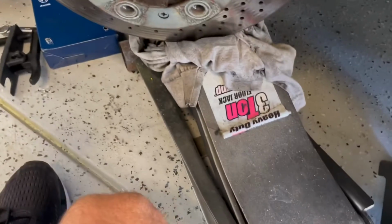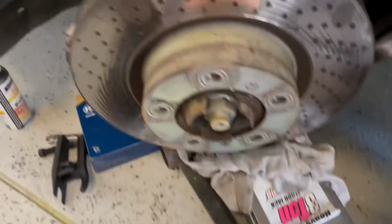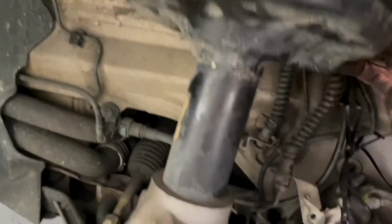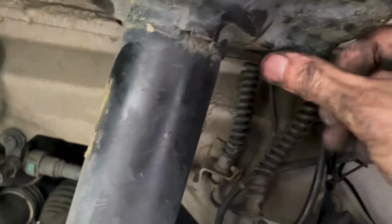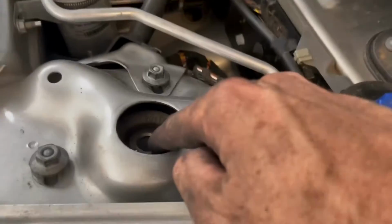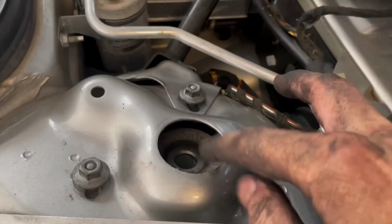All right, so now I've got my jack on the bottom of the A-arm. I've got my spring in and it's indexed into this little detent down here, so it's up against that as far as it'll go. Got the strut mount in. I've got the strut going through the little tiny hole up there. And I did forget to put my washer in. I'm gonna do that. And so I had to drop the mount back down, put that in.